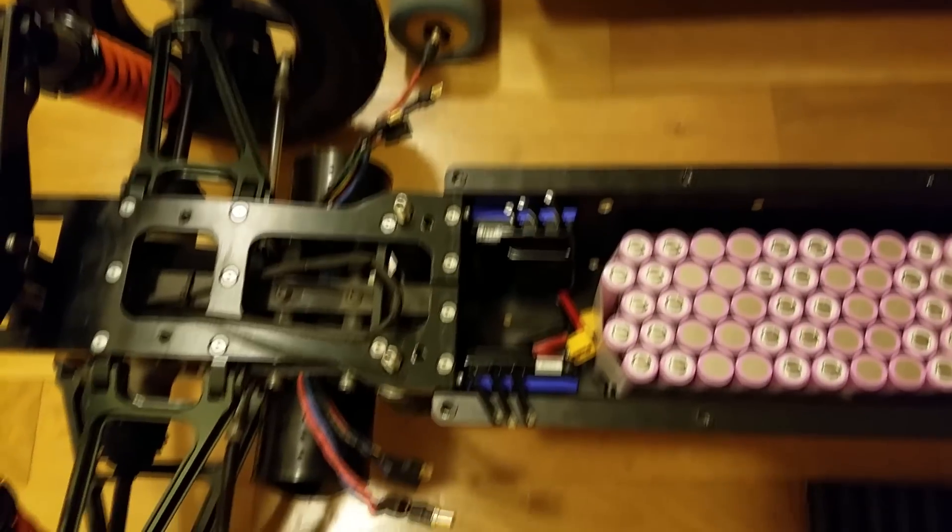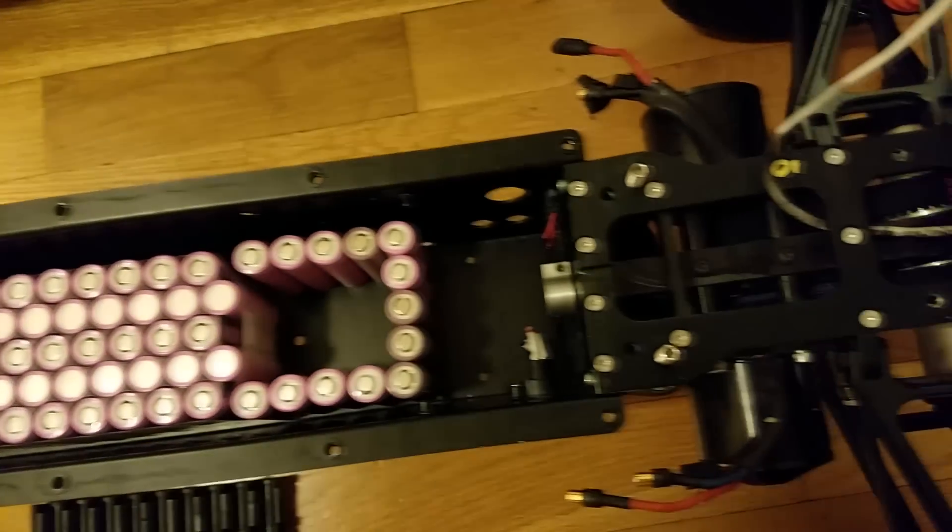I measured the board, took all that nonsense out, and laid down the battery. I initially wanted to do 12S. The problem is at 8S with the original speed controllers on this Baha board and this gearing, they advertise 35 to 37 miles an hour. If I go 10S, that's about 5 to 6 miles faster — let's say 40. That's already a bit too fast. If I go 12S, that's another 8 volts, so another 5 to 8 miles an hour. I usually calculate about 1 mile per volt, so that's going to be between 45 and 48 miles an hour, which is definitely not safe.